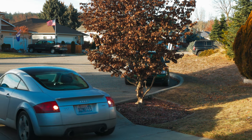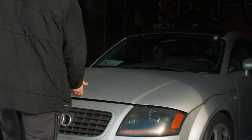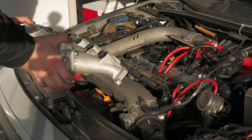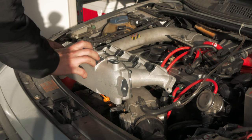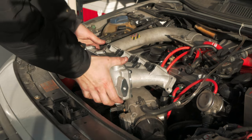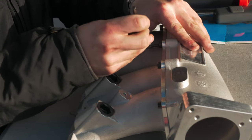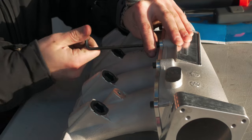Stock 225s sit on the right, and most other 1.8s sit on the left. The benefit to being able to change which side the throttle body is on comes when we big turbo the car. If we end up designing our own turbo kit, we're going to have to design all the boost piping as well, and being able to reroute the direction of everything is going to be super helpful. Today, however, we just want to get this in place with what's on the car now, meaning we need to swap it to exit on the right side.